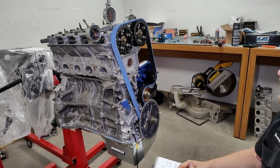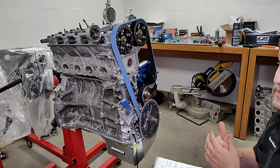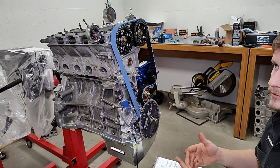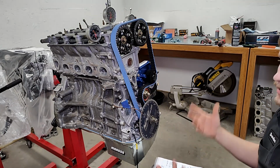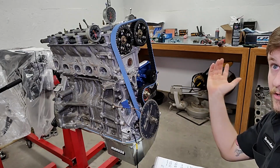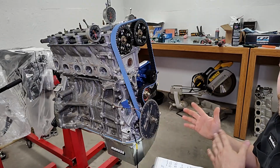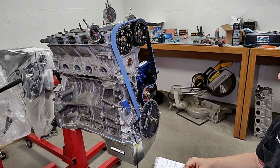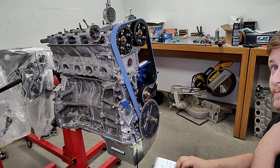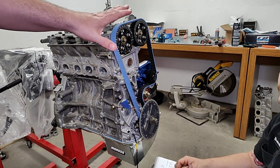We had time on the dyno, and our tuner Justin is super helpful, and he helps us out a bunch. I don't want to say he's always got time on his hands, but he always makes time for us. So we were like, well, let's see how important this really is on a turbo application. And he's like, yeah, we got time. So we started playing with the degrees and doing pulls and not changing anything other than a little bit of air, a little bit of timing, just because the cam changed, but we started picking up a bunch of horsepower. We're like, holy crap, this is rather important.